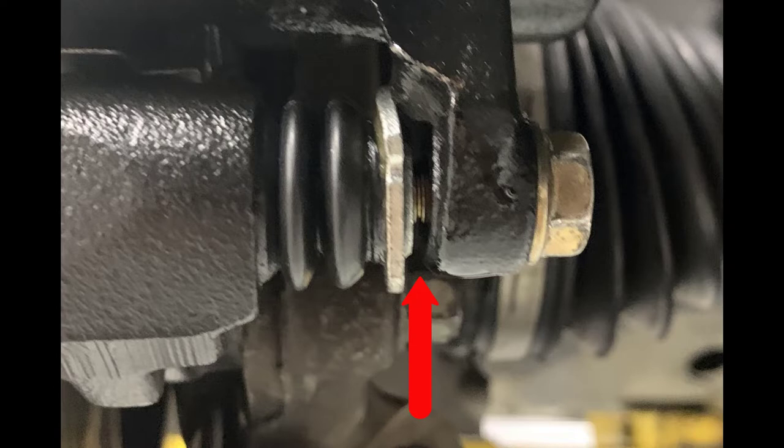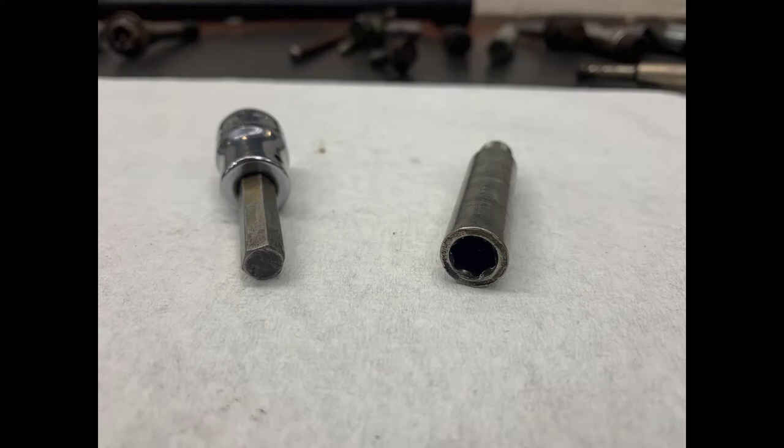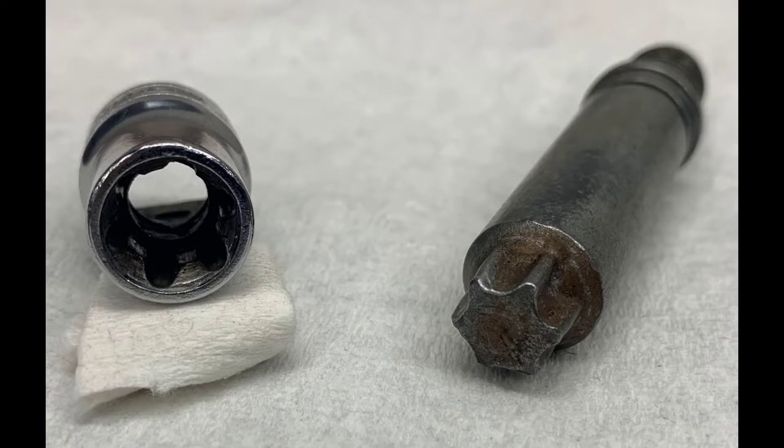You can see from this picture where the slide pin has been installed and the bolt has been bolted through the caliper into the slide pin, but there's a big gap between the slide pin and the caliper. That's because the orientation of the slide pin is not correct. The bolts will torque down and the torque wrench will click, but this is a very unsafe condition. The type of tool needed to remove the slide pin varies greatly — here we have a Torx, this is a 7mm Allen which is quite popular, and here we have a reverse Torx or E socket.